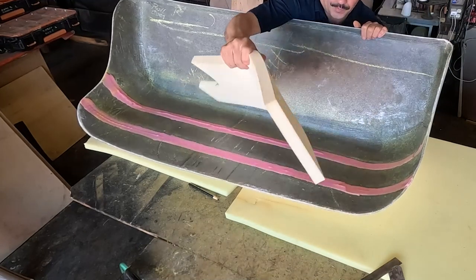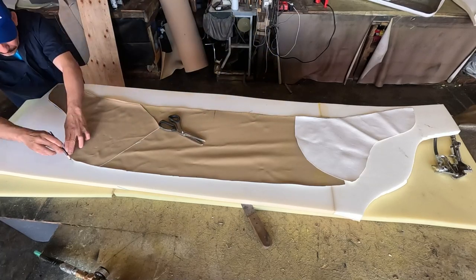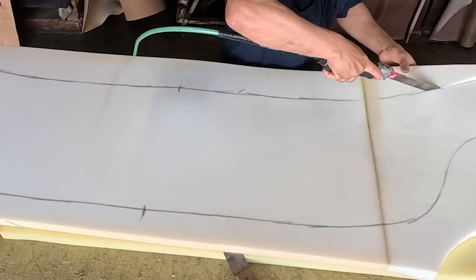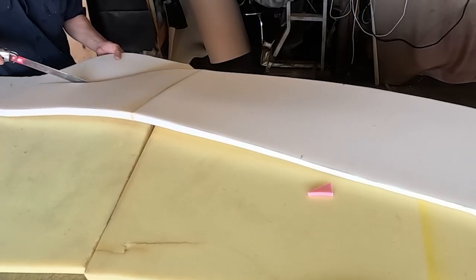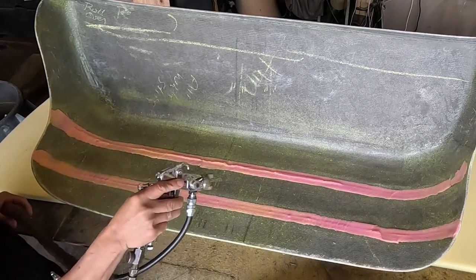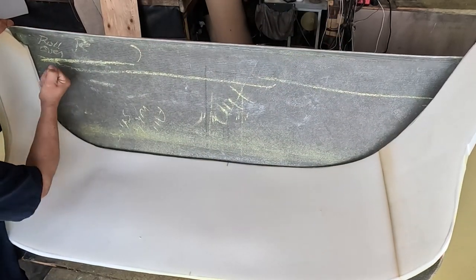What is next? Three-and-a-half pound density, one-inch foam. I layer that pattern on top of the foam, drawing all around. I will do the same with the half inch but I'm not going to show you that part separately. Then I get the knife and start cutting all around — faster and easier with the tool. Then I put glue on here — I put a lot of glue. Remember, this is fiberglass so I cannot put a staple on it, so the core will be held with glue.